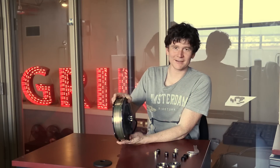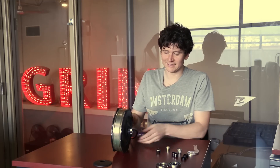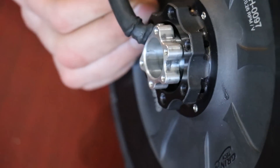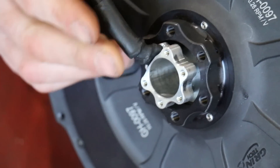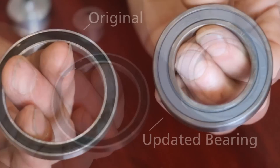So we took the time this winter to rethink the entire axle engineering to find a way of making the cable exit on the disc side. Here I have our single-side version of the Grin motor. It can still accommodate the same quick release inserts and the same 15 millimeter thru-axle inserts. If you look closely you'll see the cable is coming out on the disc side, so on any single-side installation vehicle you don't have to worry about the wires coming out through the back of the wheel. While doing that we made a few other small changes — because we had to flatten the cable to fit inside the ID of the disc rotor, we were able to use a smaller inside diameter ball bearing, which enabled us to use a larger, beefier bearing than originally, which we're hoping increases the robustness of the bearing system.